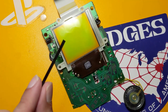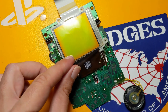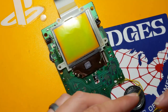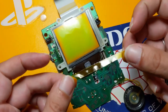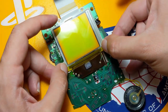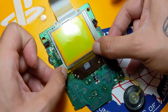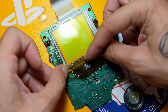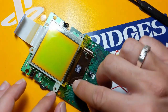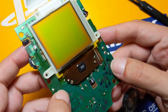Now that we're ready to reassemble the front, we can't forget about that rubber strip from before. This acts as a spacer, so it actually puts a little bit of pressure down on this strip. While we don't want there to be too much pressure on there, we do want to at least replace the rubber strip that was originally in there. The adhesive is probably worn off, and what I like to do is come in with a little piece of Kapton tape that I've trimmed down and just pop it right over the top of the rubber, making sure it's not touching the actual screen. That should be perfect and hold it in place. I'm just going to use some scissors to trim the edge of the tape, and now that we have that in place, we can put this back into the front assembly of the Game Boy and get everything put back together.